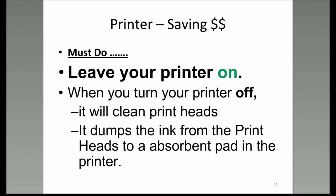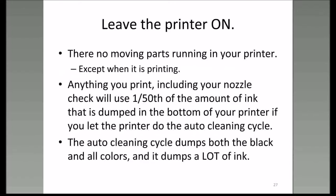You print something, then you turn it off, and again any ink still left in the printhead is dumped to that absorbent pad underneath. There are no moving parts in your printer except when it's printing—no fan running, no software running. Occasionally a little cycle will go through on your printer and heat the resistor metal plate in the cartridge, not completely enough to squirt ink out, but enough to keep the ink liquid in there.